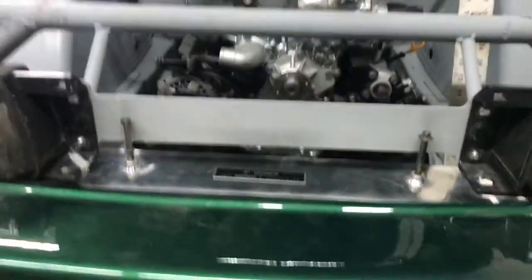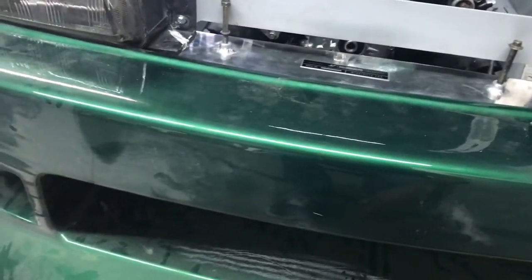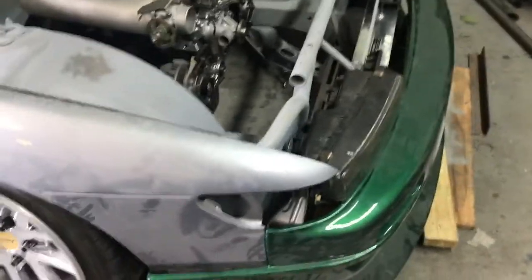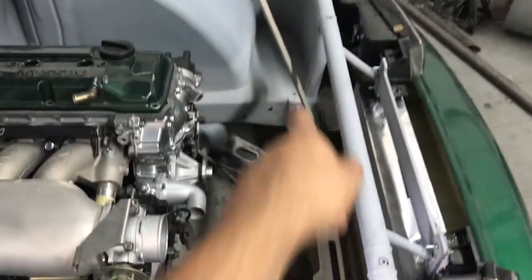What I'm gonna do is I gotta mount that intercooler. Gotta make some tabs for it, and I gotta do my bash bar for the bumper so it can not fall and not sag. So I went and got some tubing. Oh shit. Got some tubing, gotta bolt up the fender over there. And that'll be the last piece I need to weld, and honestly after that, the bay can get painted. Besides that, I just gotta cut two holes, one here, one over there, for intercooler piping.